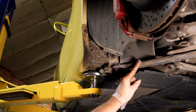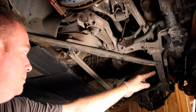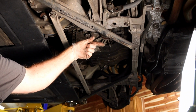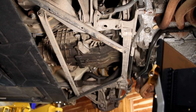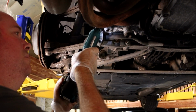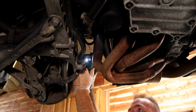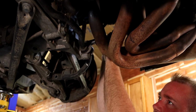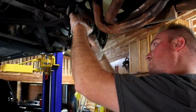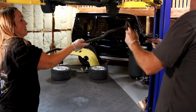Just dirty. Look at the dirt still stacked up in there. Okay, let's move on. We're going to take these bars off next. You got to take this bolt. There's a nut up here. That was nice of them. A bolt there. And we're going to take this cross member out. We're trying to clear a pathway for the transmission and engine all to drop through the bottom of the car. We're going to pull off. Oh, it's lovely. So I can strip it out real quick. There's that. And set that over there in front of the car.